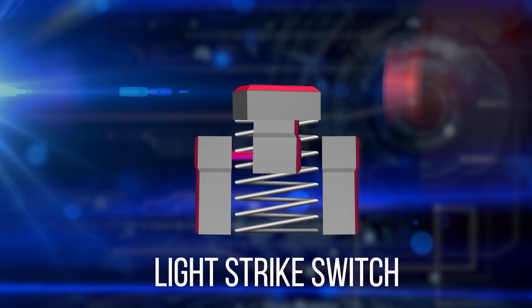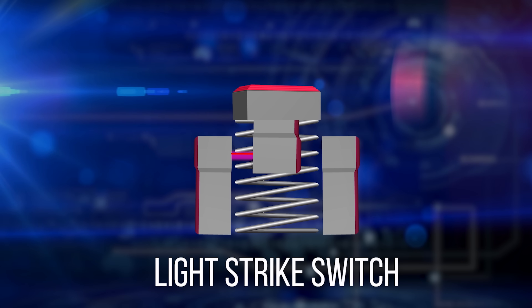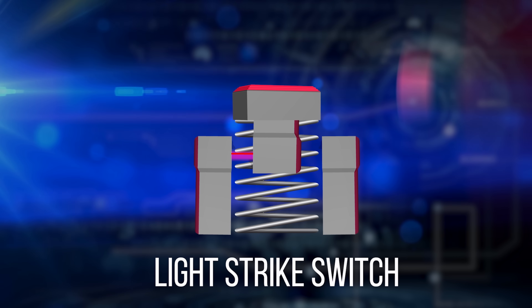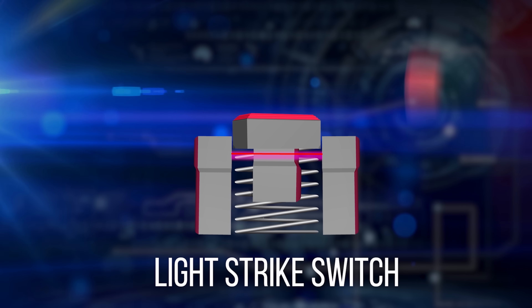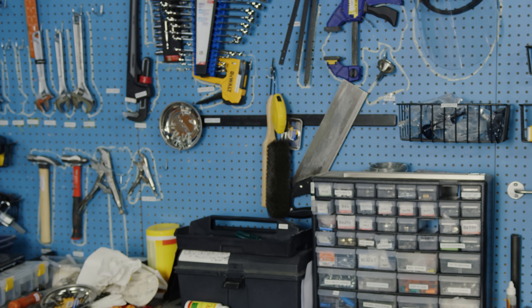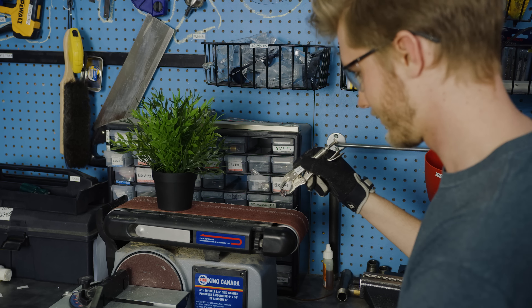Let's talk about the switches first. Unlike most other mechanical keyboard manufacturers who use switches from other companies, A4Tech uses its own LK switches, which work by causing a beam of infrared light to shine through a cavity inside the switch when it's pushed down, which then hits a detector on the other end. You can't exactly see this effect when you're typing, so we pressed our resident mad engineer Alex into service to have him cut open one of these switches with that collection of power tools he's always looking to use on something.